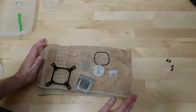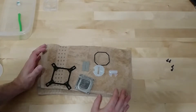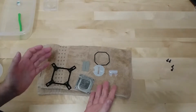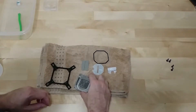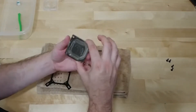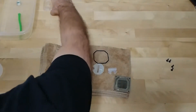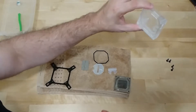You can wait for everything to dry, but it doesn't really matter if the CPU block is completely dry when you reassemble it — because what happens when you fill it with water? It'll get wet. As long as all the seals are good and you wipe everything off, it's fine. For this board, we want the fins perpendicular to the die — so this orientation. The top in the case will be oriented this way.